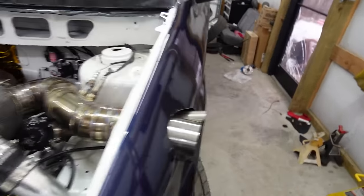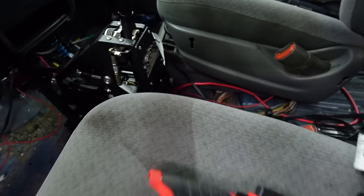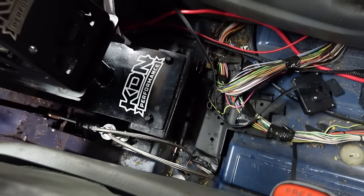When I was putting the master cylinder in for my staging brake, I forgot that the feed on it is a 4AN. My lines are 3AN. So unfortunately, I had to order another fitting. They still ain't got here, but I got a buddy that's got a business account with a distributor locally. They had some in stock, so he got them for me. We got them in. We're about to put some fluid in this thing, get it bled. Fingers crossed this thing works. This has been a hell of a process. It is what it is. As long as it works, I'll be happy.